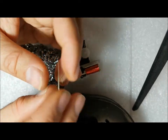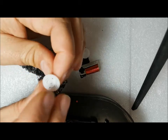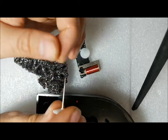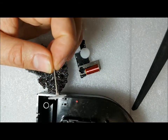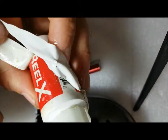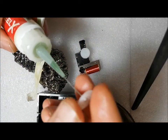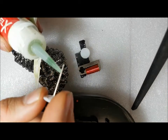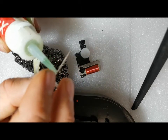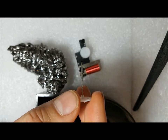The other thing we can do is lubricate it slightly. These aren't normally lubricated, but in terms of fighting off further rust, or any residual water in some of the holes, we'll put a very thin layer of machine oil on, which will protect it. Luckily I've got this Reel X oil here — it's actually made for fishing reels and it's really space-age stuff. We'll just put a very thin layer on the axle. That's all we need in terms of lubrication — there isn't actually any drops visible, just a very faint layer.